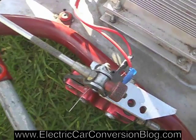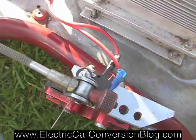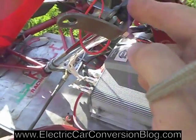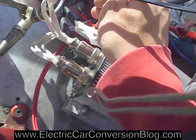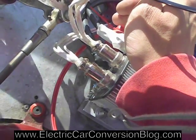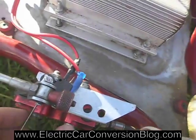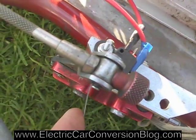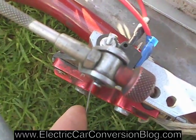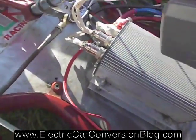It turns out I seem to have a bit of a faulty micro switch here, which is used to tell the controller that the brakes have been activated. Normally if I turn it on, I shouldn't be getting this 1.3 error code, but I am. So I'll turn it off and make the micro switch as if the brake is not pressed at all, and then I'll turn the switch on and have a look.